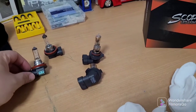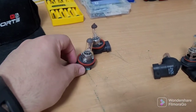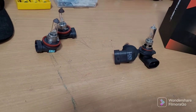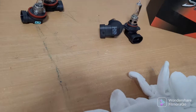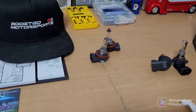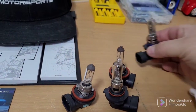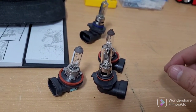These are all the bulbs I pulled out. Here are your 9005s and your H11s. When you put the LEDs in, make sure you separate your 9005s and your H11s. Make sure you use the gloves so you don't get any dirt or grease on your LEDs — otherwise you could damage them or they could go out. Make sure you read the instructions and use the sticky pads for the little resistors that come with it. Just take your time with it.